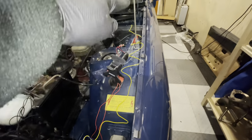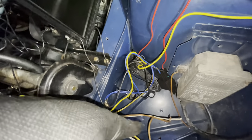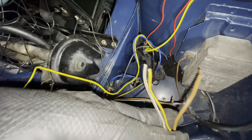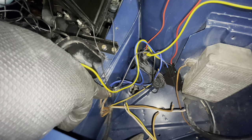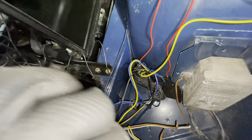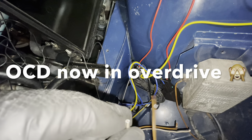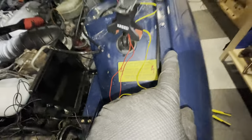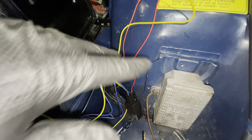I've got the yellow line going backwards for the fog lights. This yellow line needs to be hooked up to one of these wires down here, but I've cut through all three of them, so I've got these loose pigtails on both the wiring and the chassis. I've got the blue ones hooked up to earth. I need to hook the yellow wire up to one of these two — I'm not sure which one yet. I'm hoping it's the yellow one because that'll match nicely, and then the green one hooks to the other. The green one has to follow with the yellow one going into the car to form their own little wiring harness.